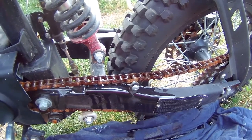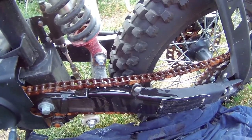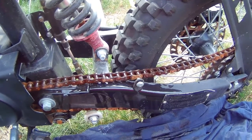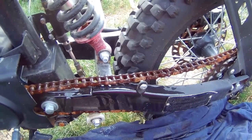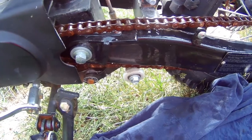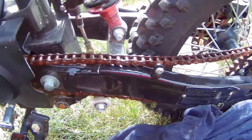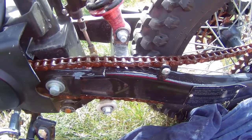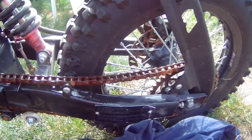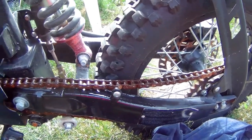That's mainly why I made this video — to advise anyone out there that's using WD-40 on their chains: don't use it. It's one of the worst things to use on your chains. If you don't trust me, search it up on the internet. You can actually use motor oil 10W-30 or 10W-40, and transmission oil is also great for chains. But I also find cooking oil works the same — the oil everyone cooks their fries with, just save that oil and it's perfect for chains. Just not WD-40.